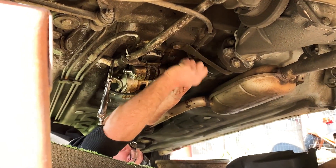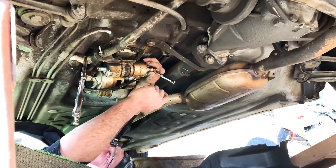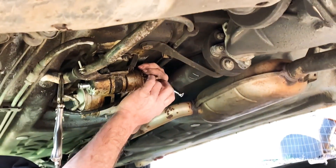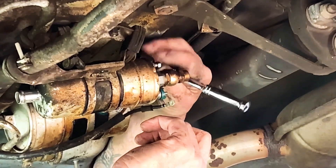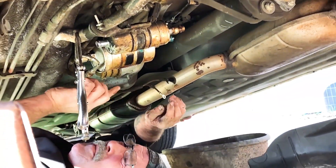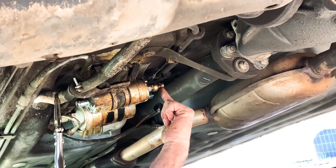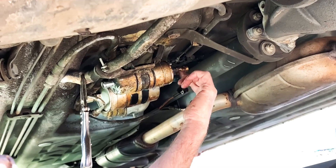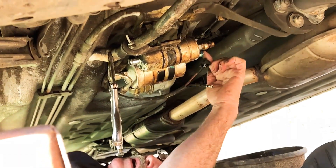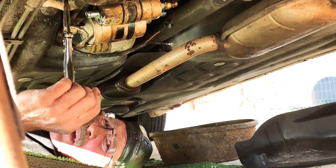We're taking the fuel pump loose now, and we've got to take these two bolts off here — these two little nuts on the ends. You have the red and the black — positive and negative, of course — and the ends are made so you can't cross them up because one fitting is a little more than the other, so the posts are a little different. So you just take them loose and slide them right off. There are your wires for your fuel pump — that's what controls power to it. Then you have to take this little bolt here loose. It screws up in here and seals with some brass washers — you don't want to lose any of them. The filter is done the same way because it's all built on like an injector line — a fuel line that goes to each one of them, feeding both.